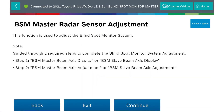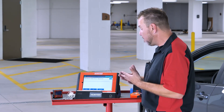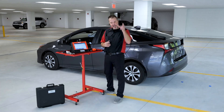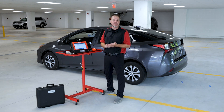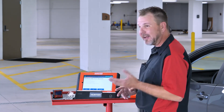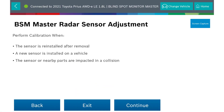This function is to adjust the blind spot monitoring system. It says here that mechanical vertical alignment of the radar sensor must be within OEM specifications before doing this. So there is a check in the service manual to make sure the blind spot monitor is okay. When that rear fascia was removed, they did check that and make sure it was in specifications. There was no damage to the actual sensor or mounting that they could see either. So we're going to go ahead and press continue, as the body shop already did that before they put the fascia back on. It's got to be calibrated anytime a new sensor is installed or sensor or nearby parts are impacted in a collision.